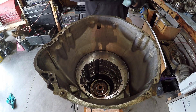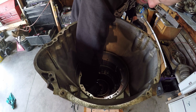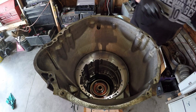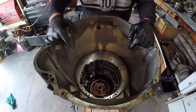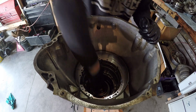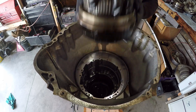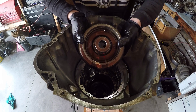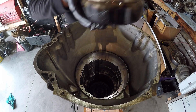I have the washer. The washer down here needs to come up. This is the clutch drum that comes on when you put the lever into drive — that's coming out next. There's a bearing right there, a race that runs around. Set it aside.